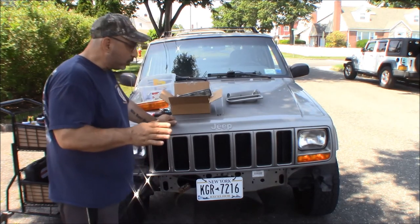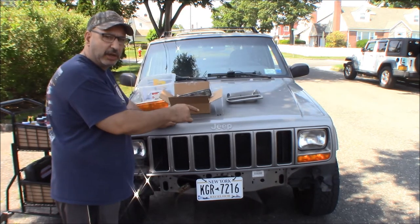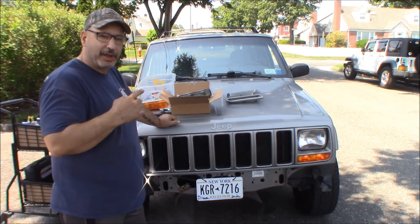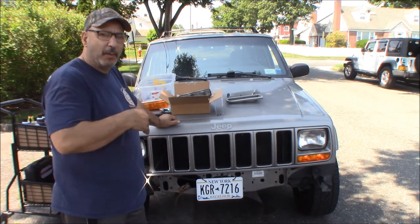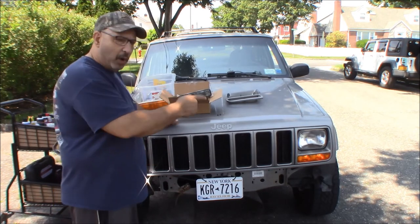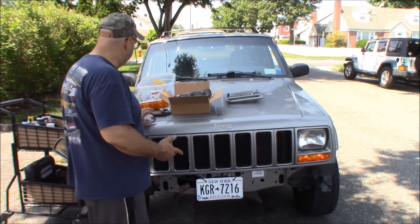So I'm just wondering if we need to go to that side and change that side to balance this out, because I believe, and my memory's starting to go a little bit, but when we were doing the taillights and we tested one side or the other, we did get a hyperflash, and when we did both sides, the electrical system was able to balance itself. So we're gonna throw some bulbs in on that side, and then we'll see if that makes a difference or not.